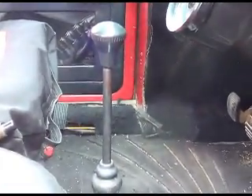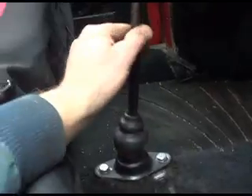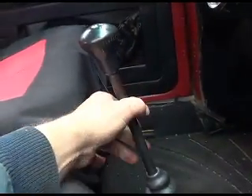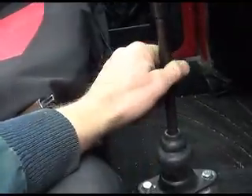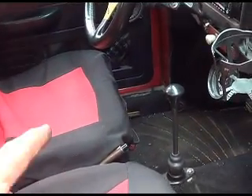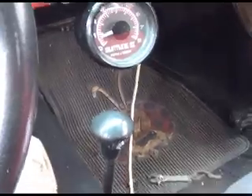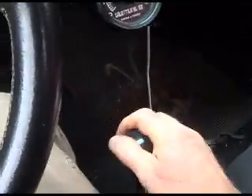Hindsight is 20-20 — I should have measured it with a tape measure. Here's the seat and the door frame, and I did move the seat back on the driver's side so this probably is worth it. There's first and there's second — it's definitely a shorter throw but I can't tell you by how much. Now this is a $15 quick shifter, but if you go with this quick shifter you better make sure that bushing in the tunnel is tight and that your coupler in the back is just as good as it can be.